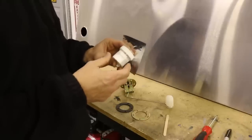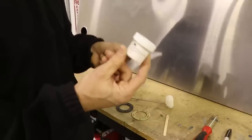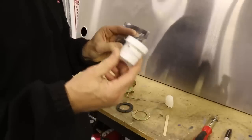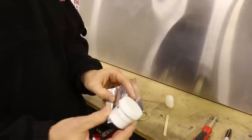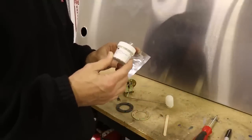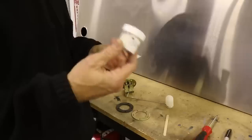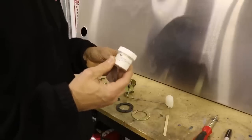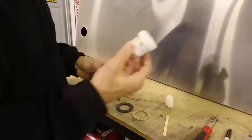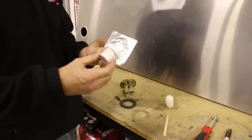I used Pro Seal on my RV-7 for the tanks, on the Cruiser, and now in this Super Duty. I think these are about $15. There's enough in one container to do both fuel tanks, but I really recommend you buy two of them — use one for one tank, one for the other. If you mix this up and try to do both tanks at once, you're going to have to rush before it starts to harden. So use one for one tank, and when you're ready for the other tank, open a fresh container. We're still going to use the rubber seal, but we're going to seal everything with Pro Seal.